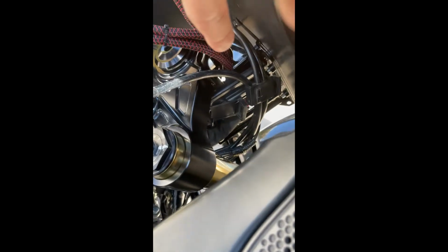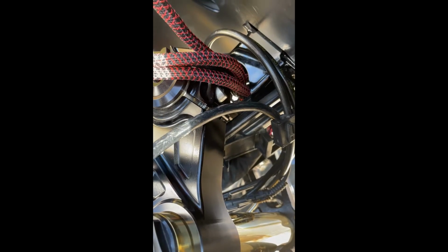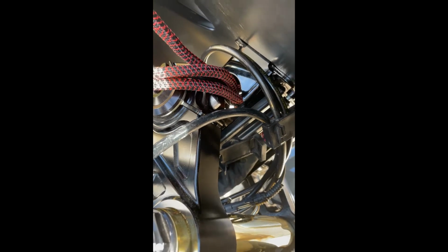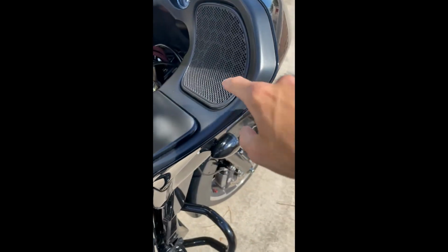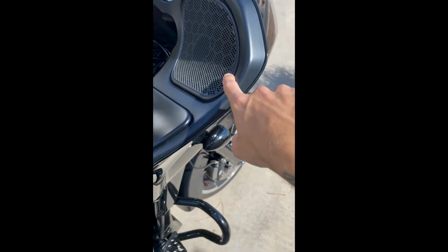And as you can see down here, those side connectors. I really didn't see much online about how they got those in there, so I went ahead and pulled the outer fairing off. In order to do so, you have some bolts inside of your speaker grills, so you'll pop these off, loosen those bolts.